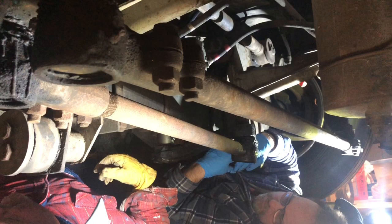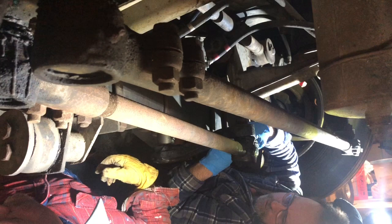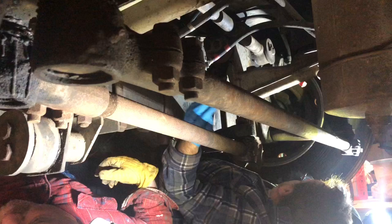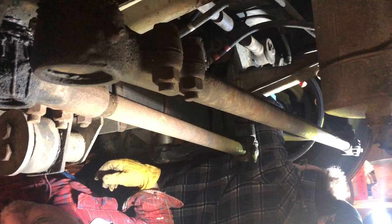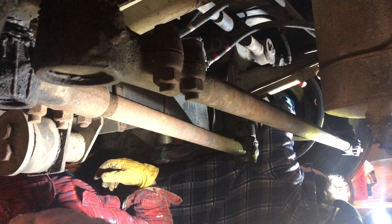But last time Scott was here, maybe you guys had it jacked up and maybe he looked at your kingpins. But I don't feel any. See where the wheel moves compared to the axle? Oh, right up there. The kingpin goes right through there. Oh, that thing is nasty, greasy in there. Yeah. So if you have slop in your kingpins, that could do it too. A little harder, Matthew. So, what would we feel, if anything? Just feel where it's steering, and you should feel steering, but there shouldn't be any lateral movement.